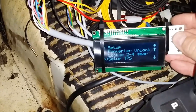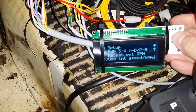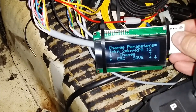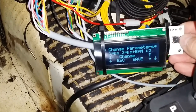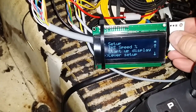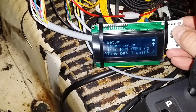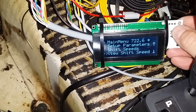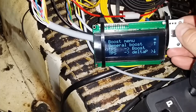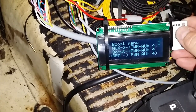Next I came in and used internal speed and RPM — it's set to two because I'm not using my external speed sensor right now; it's calculating based on information from the transmission. I set up a standard Mercedes shift lever, so it's zero. There was a boost setup as well, but it was already configured based on the information I gave them, so it was already set up correctly.